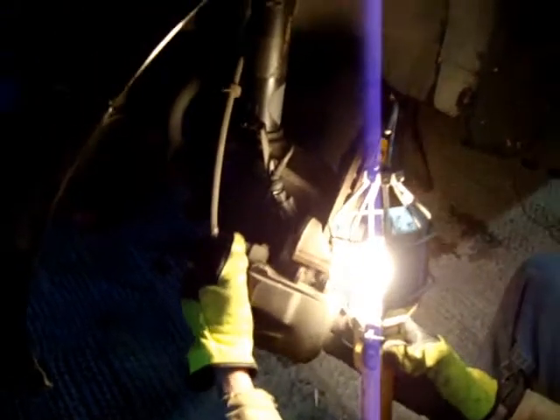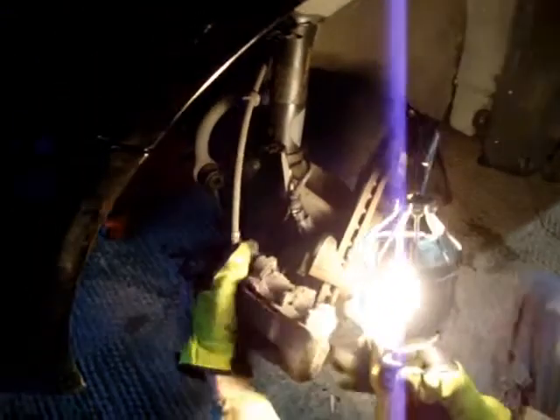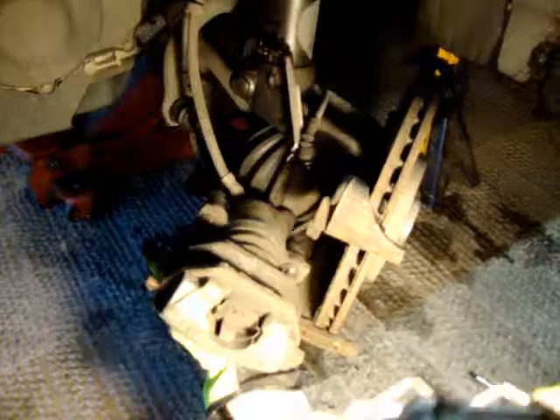First, we're going to pull these calipers off the disc brake. I'm actually to the point where the wear sensors had triggered the light on the dash. You can see that basically what it is is just a circuit that runs through here, and once the brake pad wears so far, it just breaks the wire and then it makes the light go on.